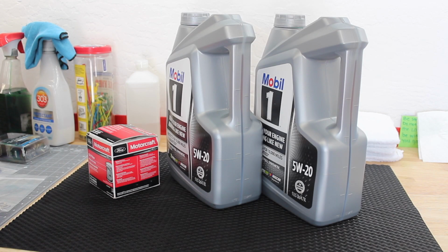Today I'm going to be doing an oil change on the 2011 F-150 Raptor, and I'm going to be doing a little bit of a different oil change from the other videos that you see on YouTube, in that I'm going to be using an oil extractor. So coming from the German car world and Japanese car world, I'm really commonly using that extractor to change oil as opposed to dropping a drain plug out.